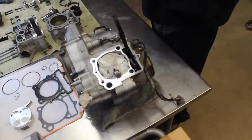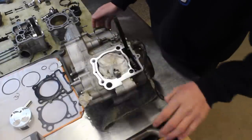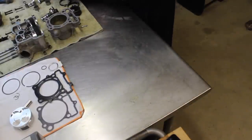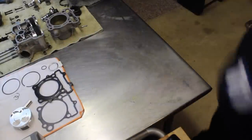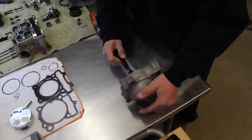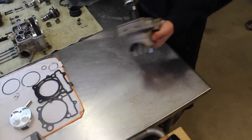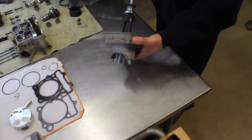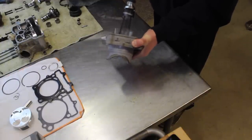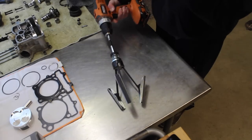What's up guys, Stratagous11 here. Today I'm going to walk you through how to rebuild a top end on a KX250F. First step, clear space and take your cylinder. Before you hone it, inspect the cylinder to see if there are any major gouges or scratches. If you can feel them with your finger, they're too deep and beyond service limits — you'll need a new cylinder. But this one's fine.